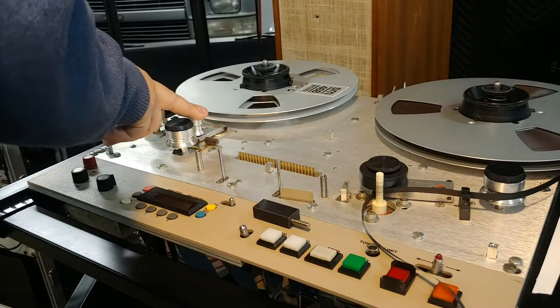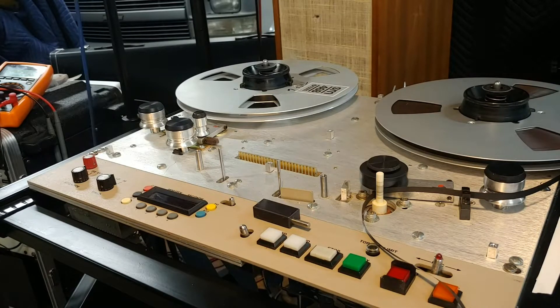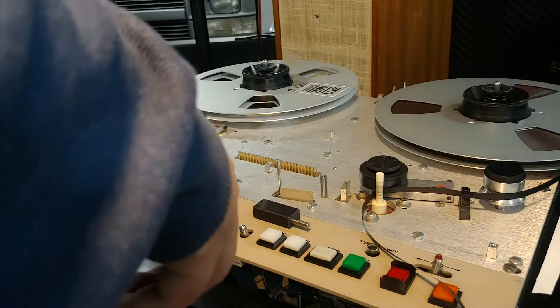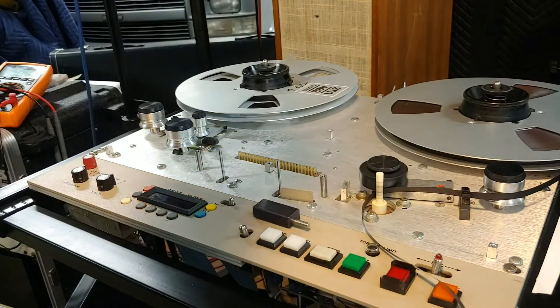This has the Roly roller on this side which makes it nice and smooth. I've gone through dozens and dozens of these machines at this point — fixed damn near every issue you could possibly imagine. Full refurbs including new sockets, new Molex pins, female and male — an actual refurb, not a turn and burn. This one will be for sale. It's a nice two-track with a fresh relapped head back from John — 90% life on it, that'll last you a long time.